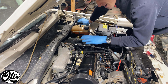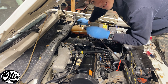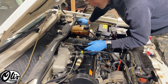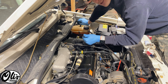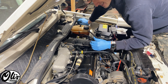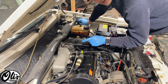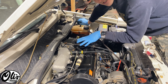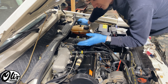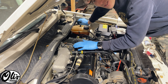All right, there you have it. It took about five minutes and now you've replaced the grommet. This grommet is actually important to make sure it's in good working order, because what was happening is there was air getting sucked in past this grommet into the engine — air that is unmetered because it is entering after the mass airflow sensor, and also unfiltered. That's really not ideal when you have unmetered and unfiltered air going in there. Additionally, it was also just leaking a bunch of oil. Now the car is going to idle much better. Thanks for watching.